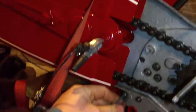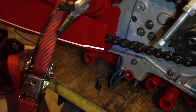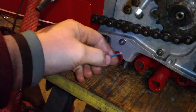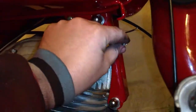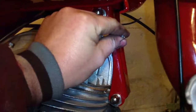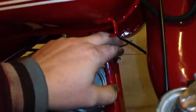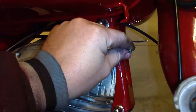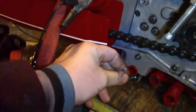Somewhere here will come a brake switch. So at least one of these wires is going up and goes here. So this will be our plus for the rear brake light. So you need to connect this one minus to the horn and these 2 together, and you will also give power for this part here.